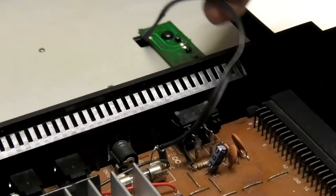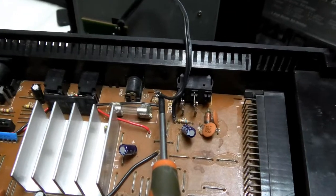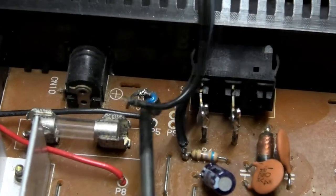Once the system's the right way up again, you should be able to lift that top piece with minimal difficulty. When you lift back the keyboard section, you have to be careful with these two ribbon cables, as old ones could go bad and break easily — so we're not taking any risks with that. There are also two others soldered to the board you need to be aware of.